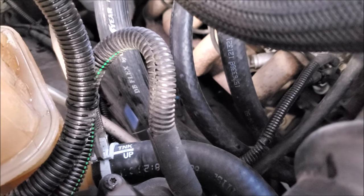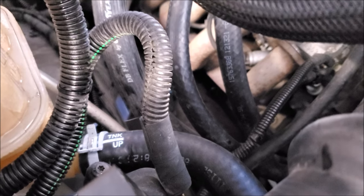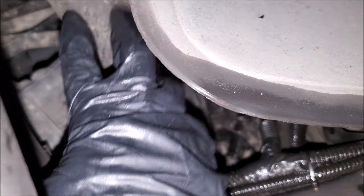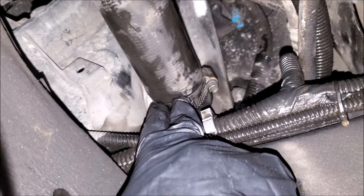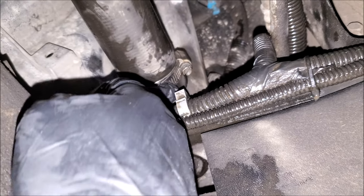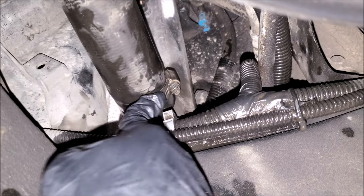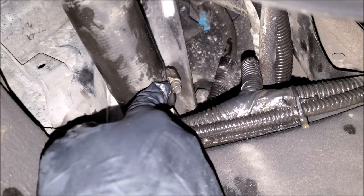GM glues and locks the tabs for you on these self-tensioning clamps, so you have to mess with it a bit but then it's on there. We're making sure that our radiator hose is in good condition and we have the clamp back on in the exact same spot it was before, tightened up. For hard-to-reach places like this I prefer worm clamps — much easier to deal with than trying to get your pliers in here working those self-tensioners. It is something you'll have to inspect on a regular basis; at least when you do every oil change, go ahead and inspect what's going on under here.